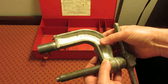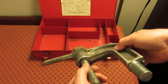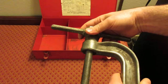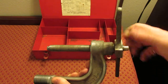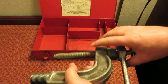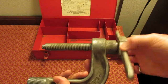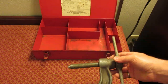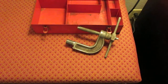Most of the parts have a number on them. This is the CG60 — it's actually got an H in the part number on some of the literature. It's got some casting marks here but doesn't really explain what it is. I really like the way this works: when you turn the crank, the shaft comes through but it doesn't spin — it's got a key the whole way and some kind of mechanism in the casting that makes this possible. So when you're turning it, it's not spinning against your steering shaft and it's not twisting your steering wheel either.